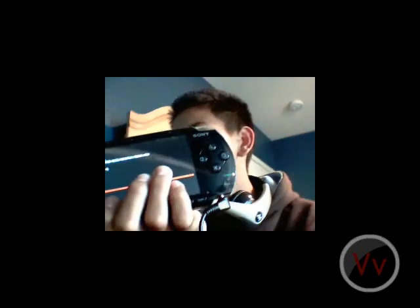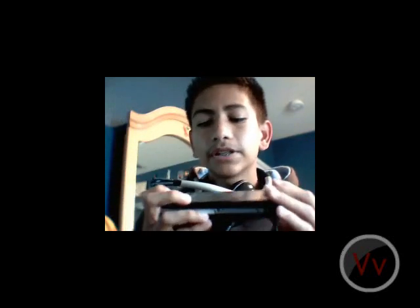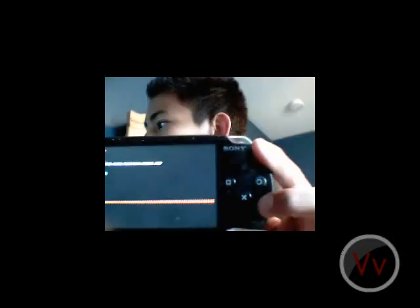The memory stick that we just took out is going back in. With the PSP still powered on, now you want to put your currently Pandora's battery in. When you do that, this light should turn orange because it's now charging the battery. The next thing you want to do, since you downloaded that program and put it on your PSP, go down to the second or third option. It's going to be: run program at PSP/game/recovery/eboot.pbp. Run that and press X.